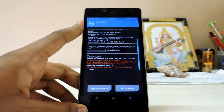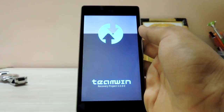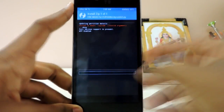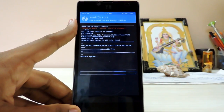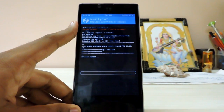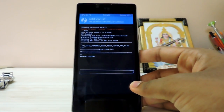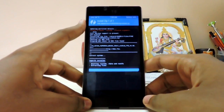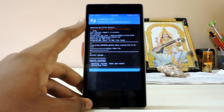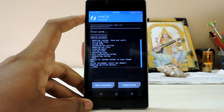As you can see, I encountered an issue — let's just reboot the recovery and try again. Apparently it's showing 'updating partition' and then 'invalid argument' when mounting the system even though I wiped it. But thank God, after five to eight minutes the progress bar completed. It seems to be rooting MIUI 8 as well, which is cool.